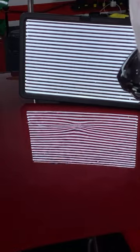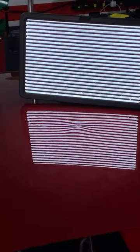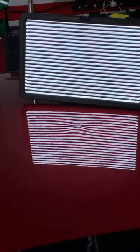This thing looks very easy. You're like, oh, that's coming out nice. And for the most part, it is. But what I'm doing is I am pushing just before I crack the paint. I mean, literally, just before I crack that paint. I'm going to bring this in just a bit. I'm trying to get these lines as tight and straight as possible without cracking.